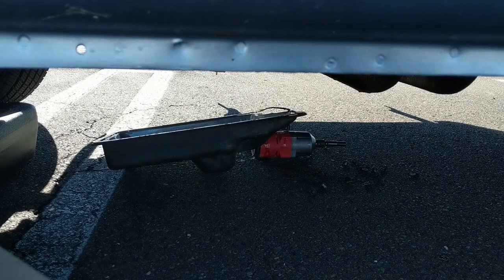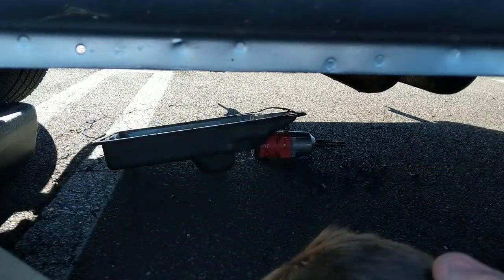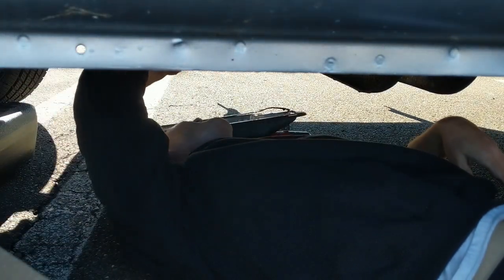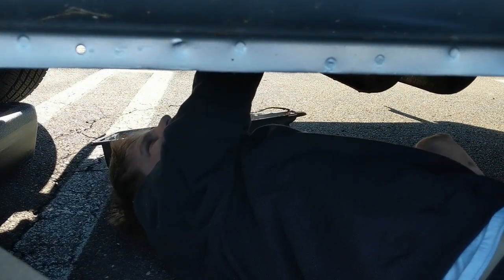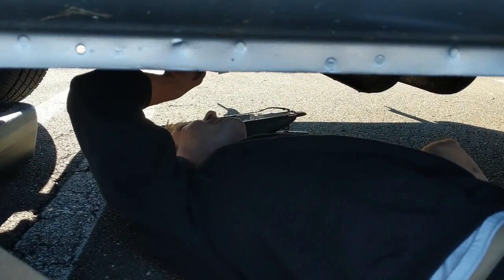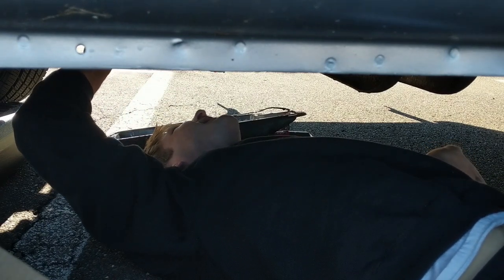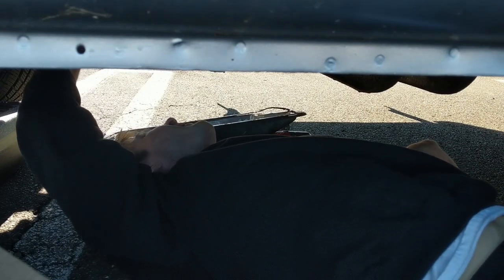All right, I think for this next part, we're gonna wanna just wipe all that excess ATF fluid off with some paper towel. So you don't have to go spinning it in your face with the gun. You're gonna have to clean up your mating surface anyway, when you put the new gasket on there. You might as well go through here with some paper towel and get rid of some of this fluid so it's not dripping all in your face. It's pretty helpful.